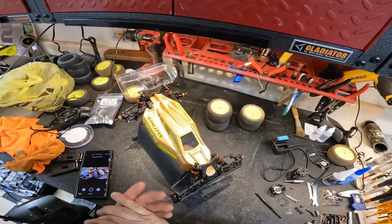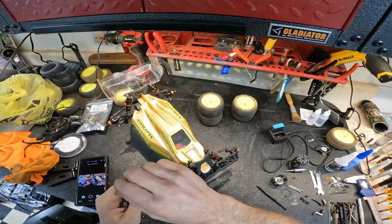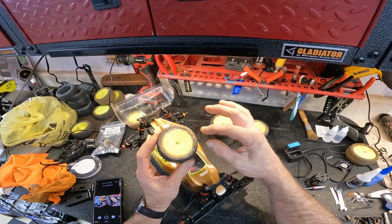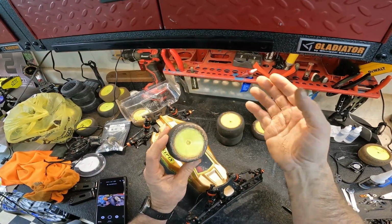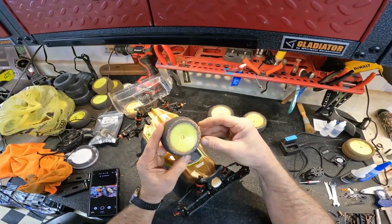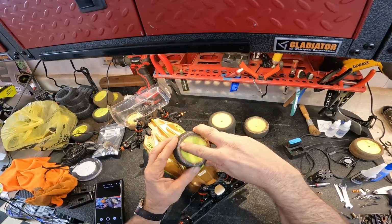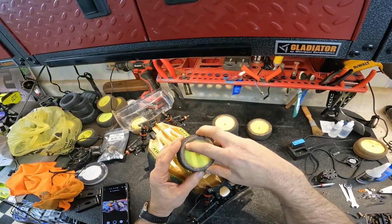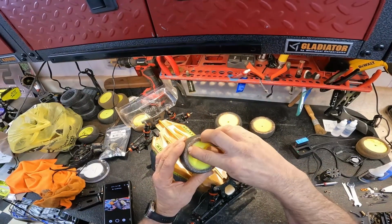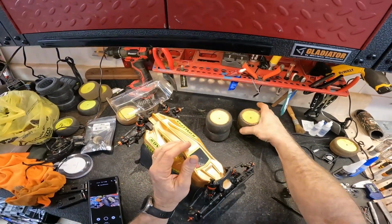So once I did that, the car was crazy fast, but had traction roll issues. So his first thing was glue the sidewall. Now this one, it looks like hell when you do this, and this one hadn't been cleaned good. The water, they had a leak and they had to cut the water off, so this was dumped in a dirty bucket and wiped off. But a lot of that is the glue and the dirt sticking to it. This is after having to re-glue it all day. First, I glued the sidewall about halfway up, and it calmed the car down a lot. It had way too much steering and was real grabby, and that calmed it down. I showed that to Chris, and he said go all the way up. So I did. It made it better.